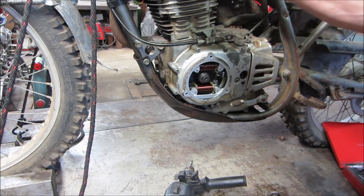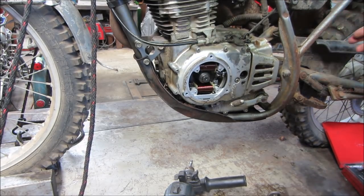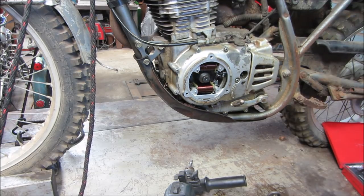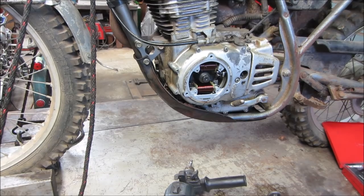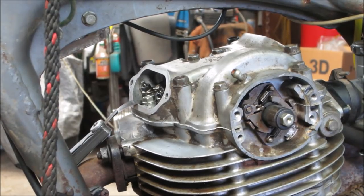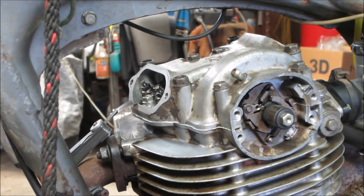The valve seal. Got some play. I'm going to set them at 3 thou, and probably let it go through a couple of heat cycles, and we may readjust that. I'm not quite sure what they're supposed to be. Probably right around 3, between 2 and 4. Yeah, put you guys on the other side of the bench. Hopefully we can all kind of fit in there. Kind of hard to see.